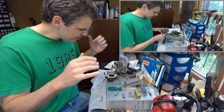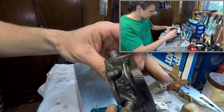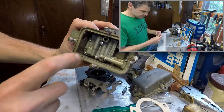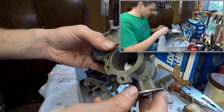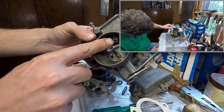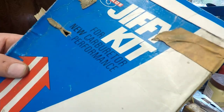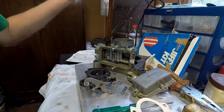Now I've got this unit pretty much buttoned up. I've done what I call the sub-assembly, so I'll show you all the things I've done. The base plate, as you can see, is in absolutely brilliant condition and has a nice ring to it. The mixture screw is in here. You can see the accelerator pump is installed, the power valve is buttoned up as well, and I've also installed the choke — you can see it there. So that should all be working absolutely fine, including the accelerator pump discharge. Now I need to put it all back together, including a new needle and seat assembly which came with this Jiffy kit — I love this new old stock kit. Then this unit will be ready to go.